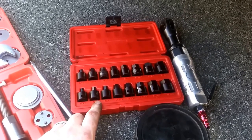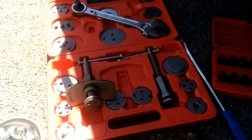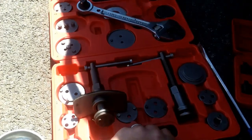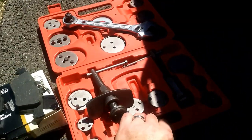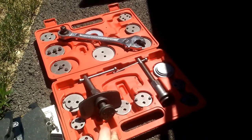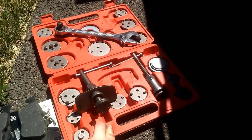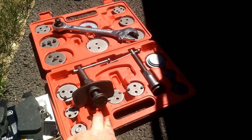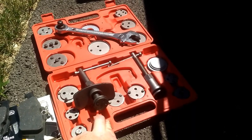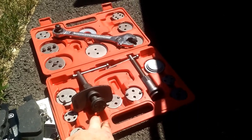If you have one of these in your toolbox, it's going to make a lot of jobs a whole lot easier. The next thing you're going to need is a piston rewinder — you can't reset the caliper the old-fashioned way with a C-clamp. You can buy these pretty cheap; this entire kit was like $22 on Amazon — I'll put a link in the description. It does about 21 or 22 different types of cars and will cover pretty much anything you need, including a lot of imports.